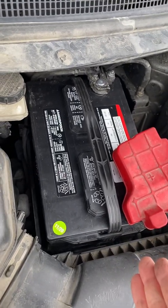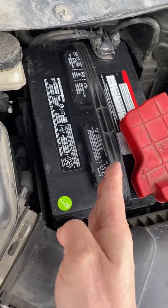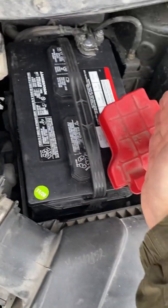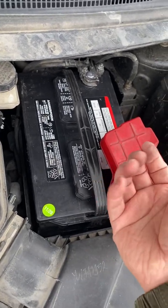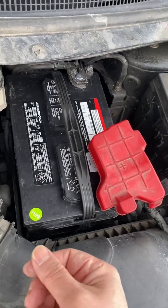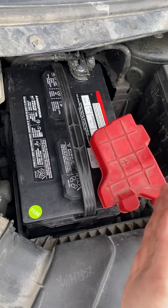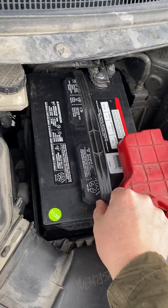When you put the new battery in, you had better go in this direction, at a little bit of an angle, and slide it in on the side. Then try to push the battery to the right-hand side, and the battery will sit in the holding place, because there is a recess area meant for the battery. The protruding edge is supposed to slide in. So you have to push the battery in on the right-hand side. The battery will sit by itself into the recess area and hold there.